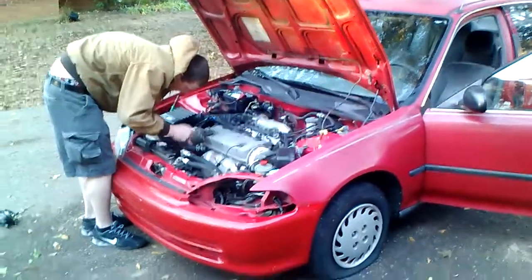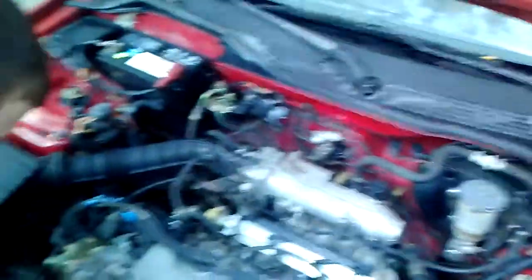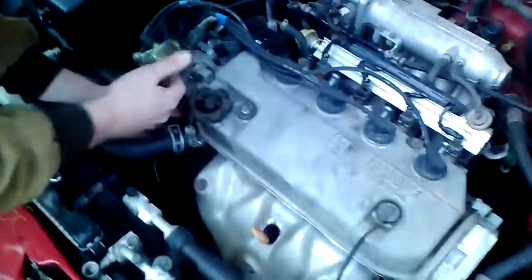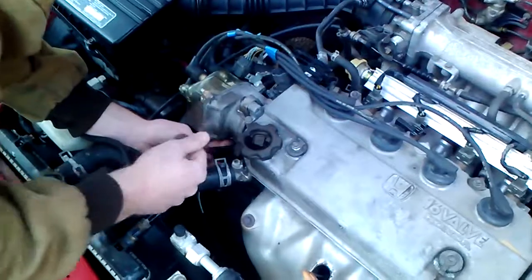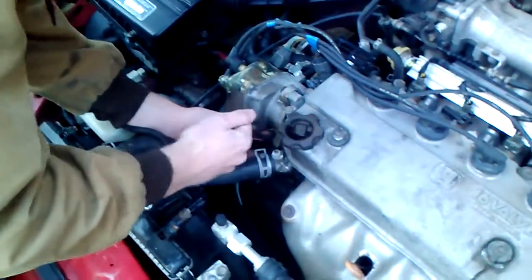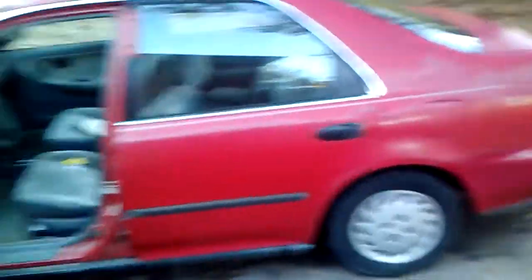It's time consuming, yes, but it's worth it. And then we gotta put the headlight and the corner light in - gotta find a headlight first. The car cleaned up really well though, so hopefully all that cleaning was worth it. Theory has it we checked everything: it should now have spark, it had compression, it had fuel. We got the computer back in it and we got the main relay in it now. We will see what happens.